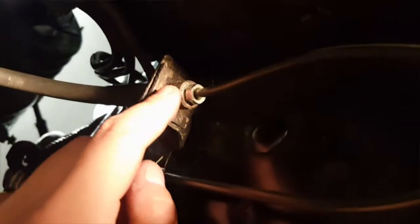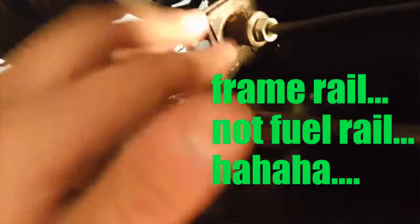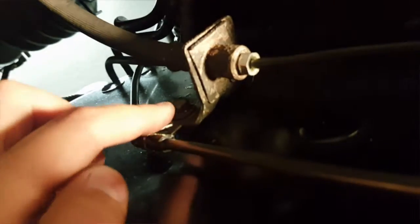When you're driving it has a bracket that connects to the car right here. This is where the hard line begins — that fitting goes here, then you come over, make a bend, and go back up through the engine bay. I routed it between the fuel lines and the fuel rail. I was able to utilize this bracket right here — I believe this bracket is actually an SR5 bracket but you can twist it around and make it work for the GTS.